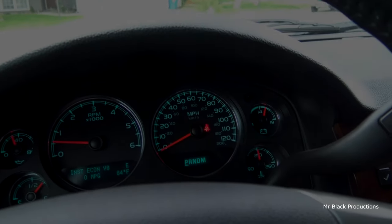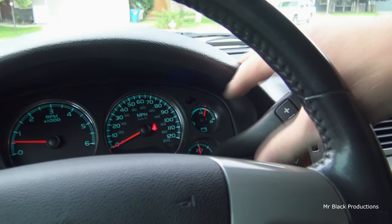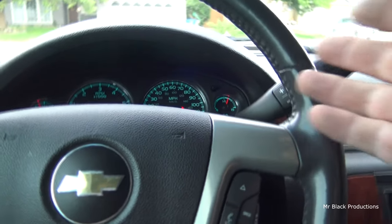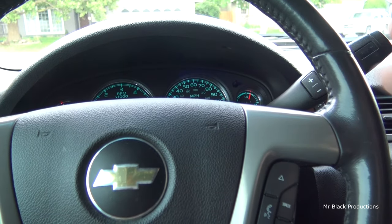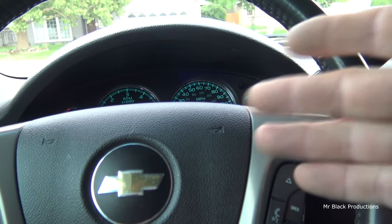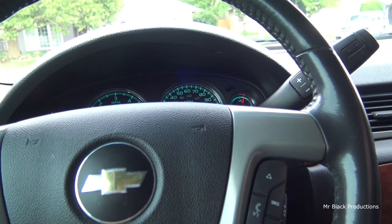Okay, now that we've overcome the seatbelt alarm, with that second alternator on, we can see we don't have any check battery lights. Anything over 16 volts, or bumping up to it, will trip the check battery system. It's hardwired deep in the belly of the computer's programming. Anything over 16 volts and it doesn't care for it.